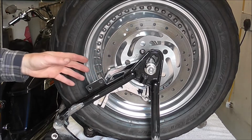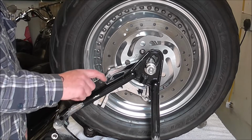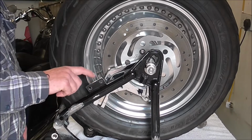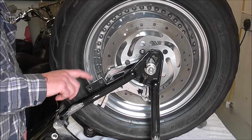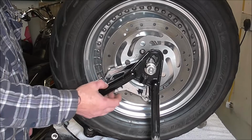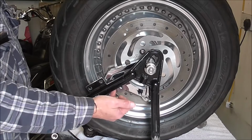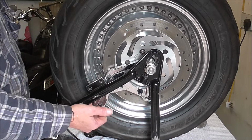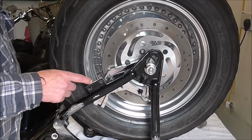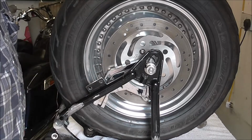I'll double check my measurements again before across here, because the likelihood is it's not going to pull because of the way I'm going to do it. There's a lot of strength in this one bracket, and I'm putting the main of the weld into that bracket. By the time the heat goes to the tube, there won't be enough heat in it to actually cause the tube to bend. And the 3 little stitches that I'm going to put on the top side shouldn't be enough to pull it. But I'll take measurements, and if it does pull, obviously I'll straighten it back up again.